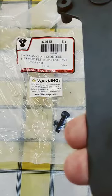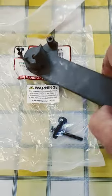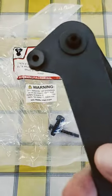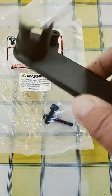So now I don't really have to worry about pressing the bearings or pressing the cams out to change those cam tensioners that are in there, which I'm kind of glad I don't have to do that. Even though I bought a press to do it, this is a much simpler solution.